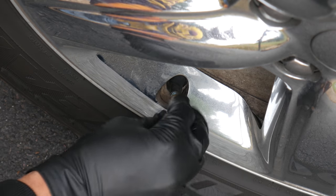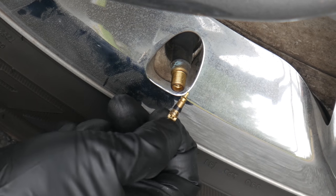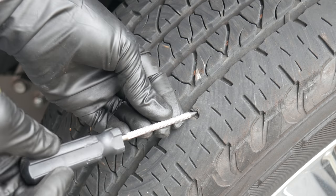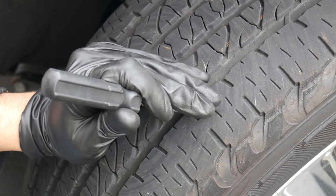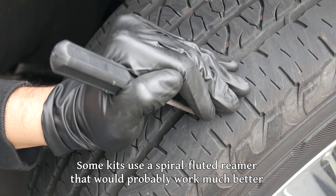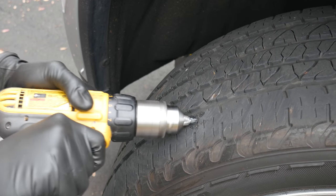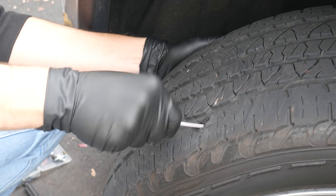We'll go ahead and use that little tool to carefully unscrew the core. If there's still air pressure in the tire, it will try to launch this core across the room, so be mindful of that. With that removed, the tire is totally empty, and we can be sure there won't be any back pressure when installing the plug. Here's where my method is going to differ from the instructions that come with any of these toolkits — they would have you push the reamer through the hole to clean it up, but a lot of tire punctures are small, and there's just no reasonable way that reamer is getting through there. So, somewhat counter-intuitively, what we need to do is make that hole bigger. In my experience, the way to do this is with a quarter-inch drill bit. With anything smaller than a quarter-inch, the plug is pretty much impossible to install. I wouldn't go much larger than a quarter-inch, but I could see a situation where you'd have to step it up a little. After drilling it out, we'll use the reamer to clean it up just a little bit more.